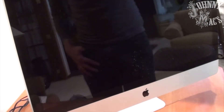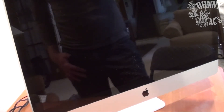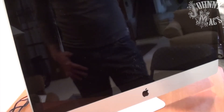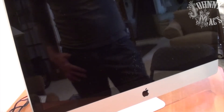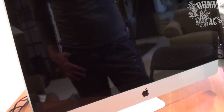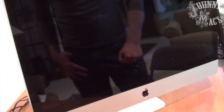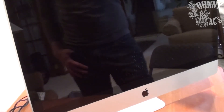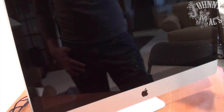Hello and welcome to another installment of Johnny Mac's Bring That Mac Back, where we take an older Mac and breathe new life into it. Today we have a 2011 27-inch iMac — a great machine with a lot of upgrade potential. We're going to replace the video card with a Metal-compatible graphics card to support a newer operating system, install two 1TB solid-states raided in a stripe for maximum performance, and top it off with 32 gigs of RAM.